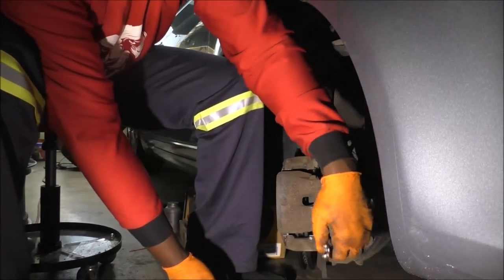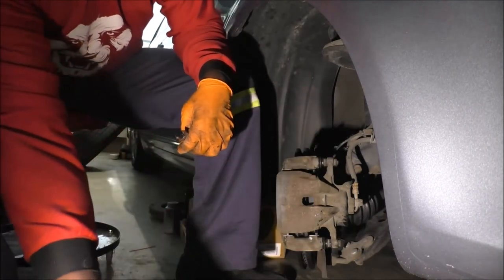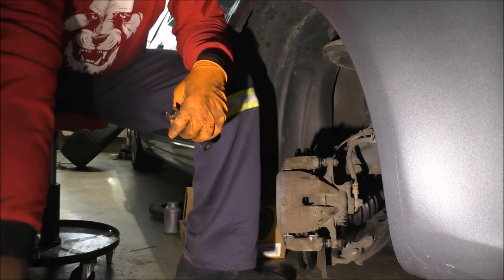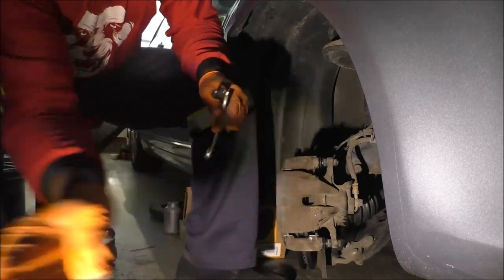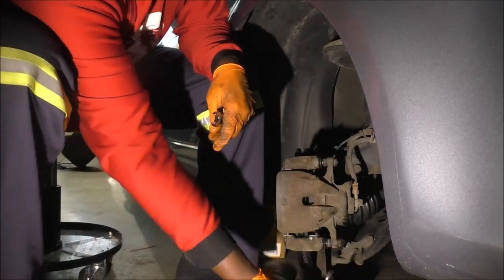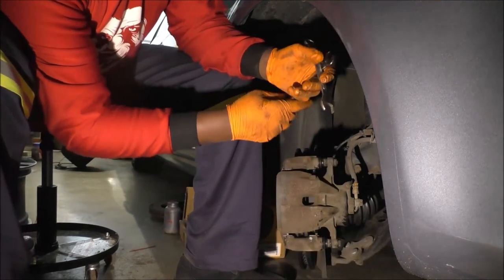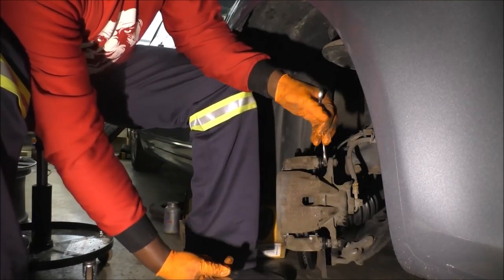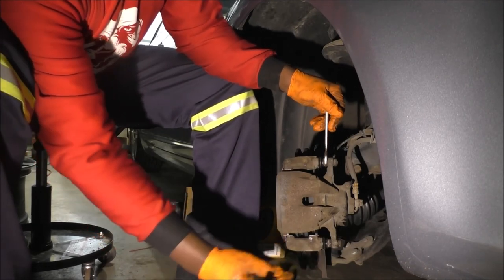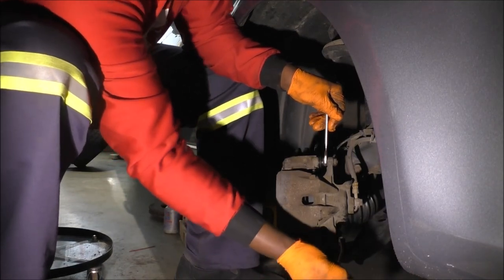So with this one here, sometimes for whatever reason, the other bolt, the inner one, might start moving. Obviously it's not happening right now, but as I said, I'll try to be as thorough as possible. So if the inner bolt starts moving, use a 17 millimeter to hold it down, and I think that's actually standard for all slide pins I've messed with. It's like they're made by the same evil person. 17 millimeter over there, while the outside is 14. So yeah, there you go.